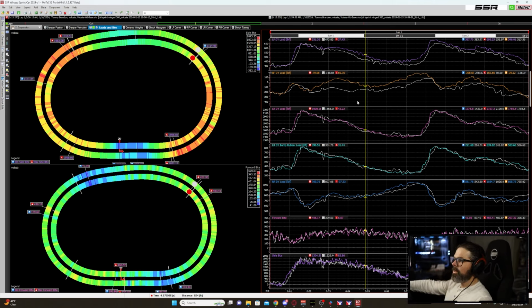All right. That's one adjustment that you can use, the left front shock. The other one is actually the right front shock. The right front shock does the same thing in terms of the weight to the left rear. If the car is pushing coming off the corner, you could increase the right front rebound and it'll keep that weight up front just a little bit longer. So we're getting good drive and we're not having too much left rear drive making it push.